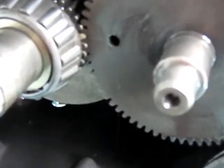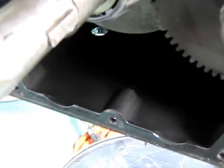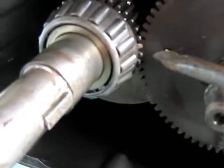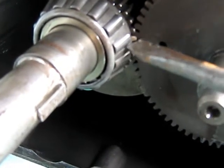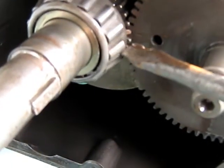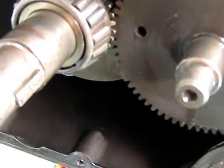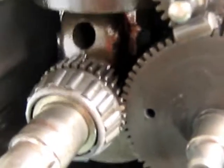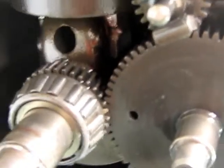Lo and behold, down here when I looked at this timing mark — you can't see it with this camera — but right across from that hole, that's where the timing mark on the cam cog is. And then there's this tooth, kind of cut off there, and that's the corresponding one on the crankshaft cog. Well, anyway, when I looked at this thing, it was five teeth off, so no wonder it didn't run very good. So I'm going to put it back together.